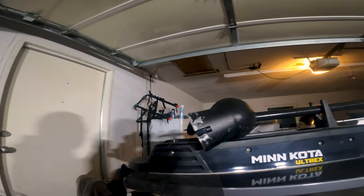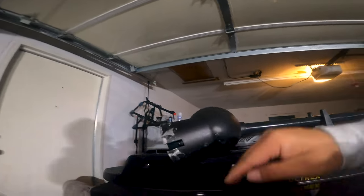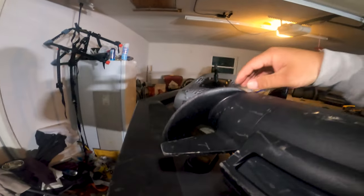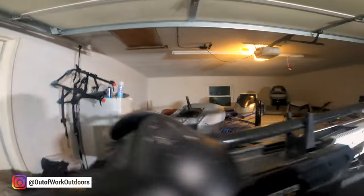Show you what I got. Just look at that right there. See how the shaft comes in? And it's crooked. And this is crooked also. And the prop is pretty banged up, as you can see. So basically, when I'm on speed 4 or 5 or higher, the trolling motor vibrates pretty bad. So I might even have a bent shaft. I don't know. So we'll see.